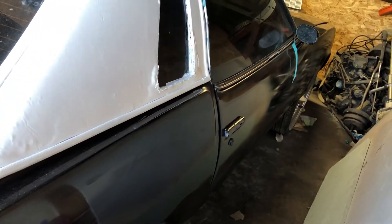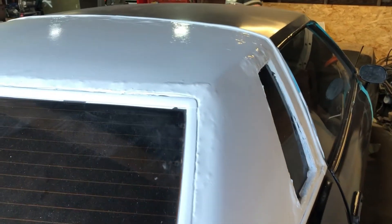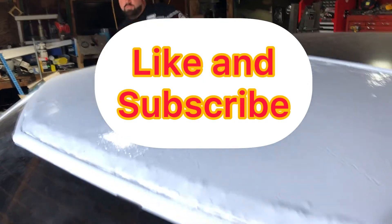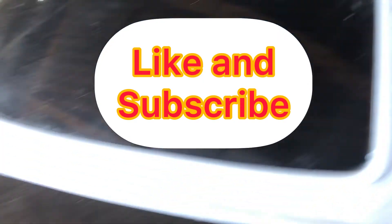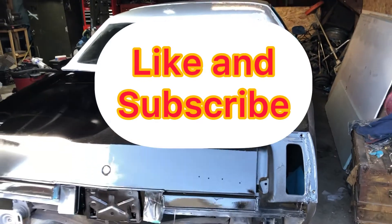Don't have your hands into it. But when we got to the hood and the trunk — trunk ain't too bad, the hood was bad. This side was super smooth, fairly little roughness, but dirt stuck to it. We painted this top with a different type of paint, came out pretty good — didn't have much to it, it's perfect. Just have to cut and buff the rest.